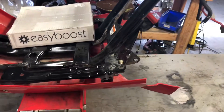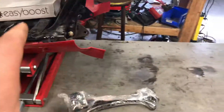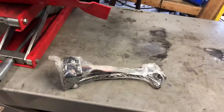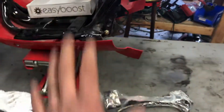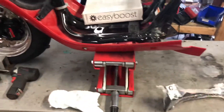Putting it back here is a stronger section of your bike and that's where more of your weight is. These are the Bozzetti side stands — we sell them and they're really, really good. They work on these bikes, they're super strong, and that's what we prefer. You do have to drill and tap, but they're worth it. Hopefully that clears things up — have a good day, subscribe, share, and like!